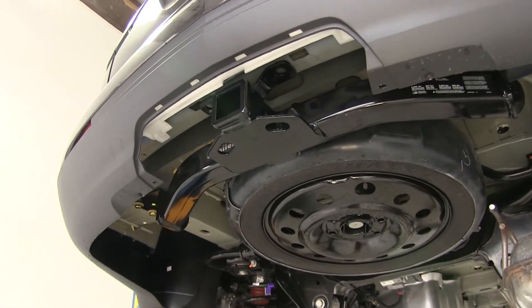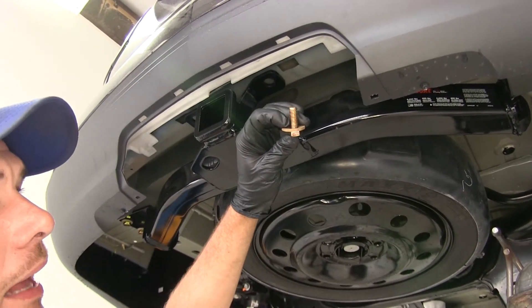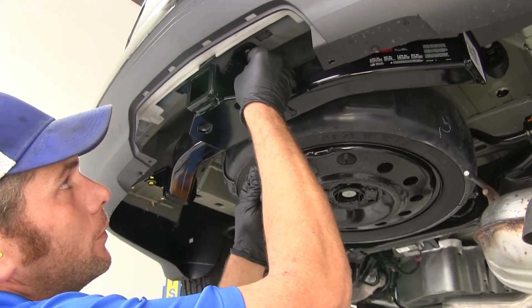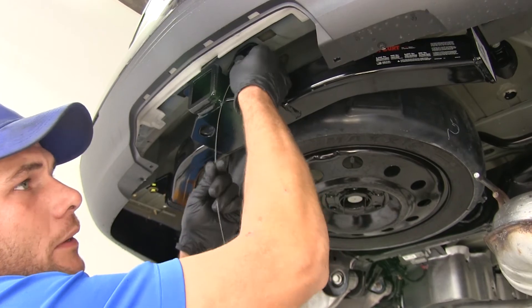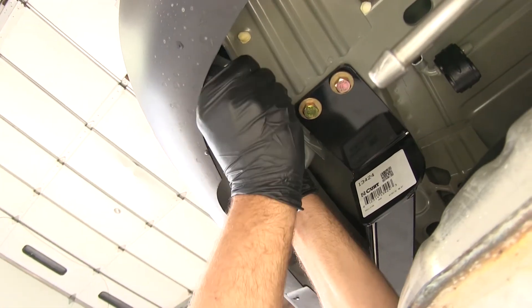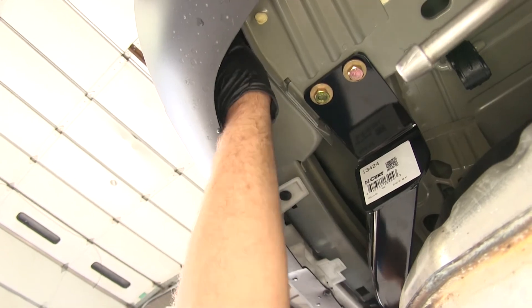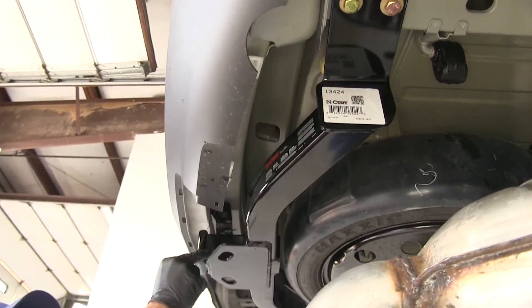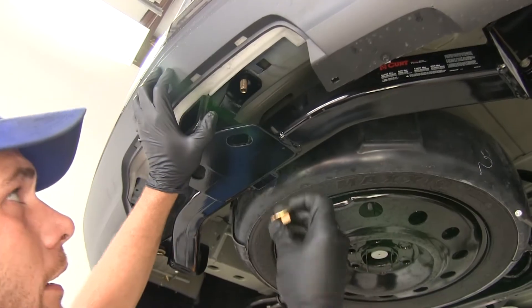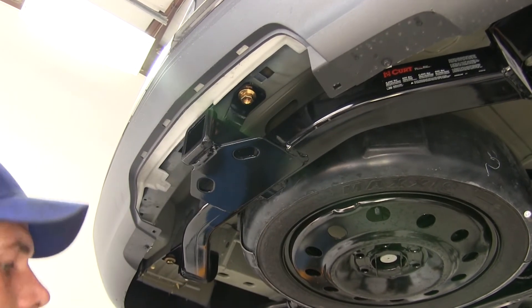Now that we've got those four in place, let's take care of our center connections. If you have existing weld nuts already in place there, just use the same hardware as the sides. Since ours doesn't have weld nuts, we'll use a pull wire — run it up through the hitch and through the hole, then direct it out towards the end of the bumper. We'll add a spacer block and thread on one of the carriage bolts, feed those into the end of the bumper separately, then bring them over and they'll come right down through the hitch. Take the pull wire off, raise the hitch slightly, and thread on one of our flange nuts. Then do the exact same thing for the other side.